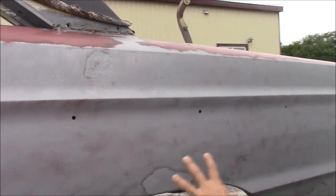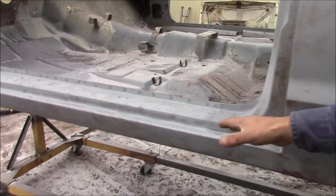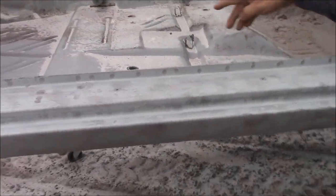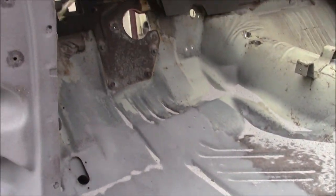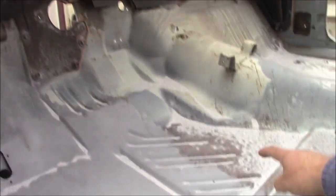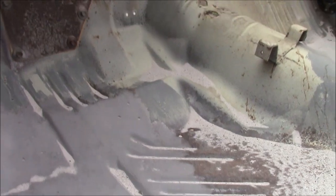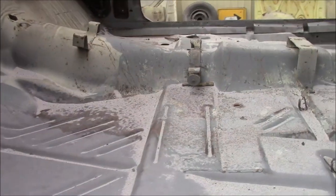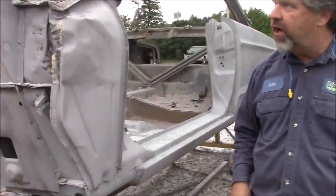You can see how nice and clean and tidy this is. As you come into the rocker panel, this is our driver's side door opening, and then we did a little bit of the floor here and we'll do more once it turns on the rotisserie. You can see the difference between that heavy rusted area and beside it where it's all been sandblasted — there's quite a difference between not media blasting and getting it all nice and clean — and then the same thing along the front.